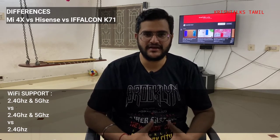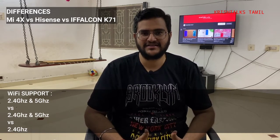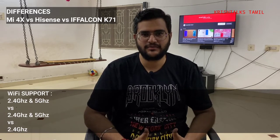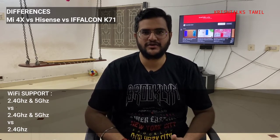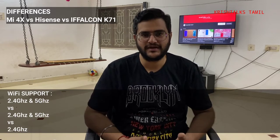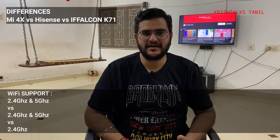Let's talk about the difference in Wi-Fi support. 2.4GHz and 5GHz are dual band Wi-Fi on two of them. The third is iFalcon - if you have a 5GHz, you can get 5GHz. But iFalcon only has 2.4GHz support. So if you have a 4K TV, you need to stream at a minimum of 10 to 20 Mbps. If you have 5GHz support, you can enjoy the speed. If multiple devices are on Wi-Fi, the 550 Mbps can be reduced, and if you have a 100 Mbps connection, you can get about 20 Mbps usable. That's why 5GHz matters.